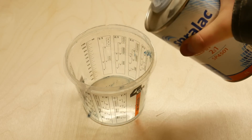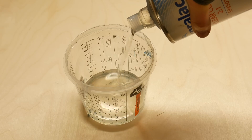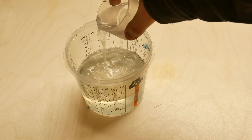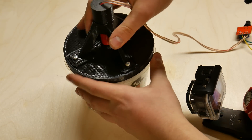Now we are finally here where we can really test this out. We start with car clear coat — be noted that we are using real ratios: two parts clear coat and one part hardener. Let's close this lid and start with the moment we are all waiting for.